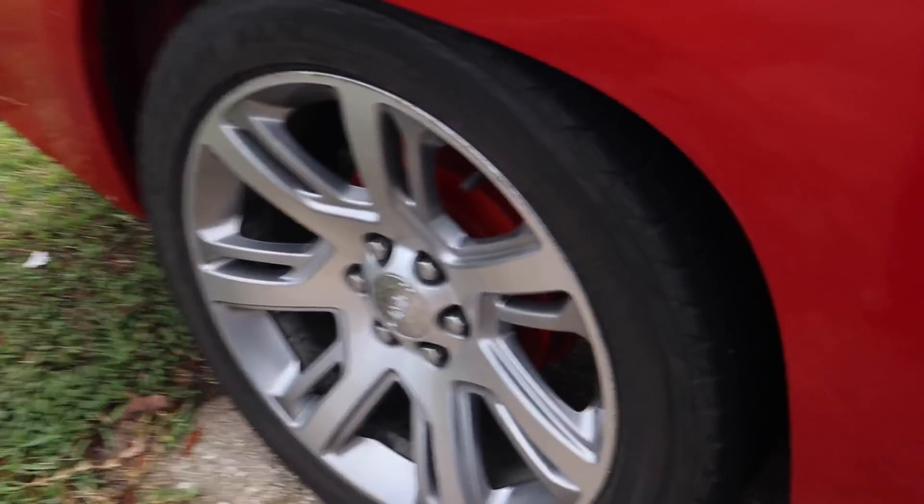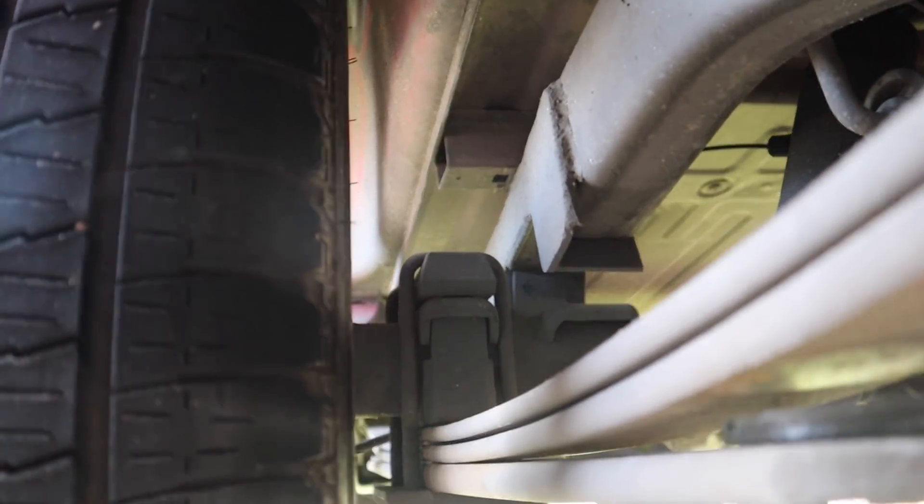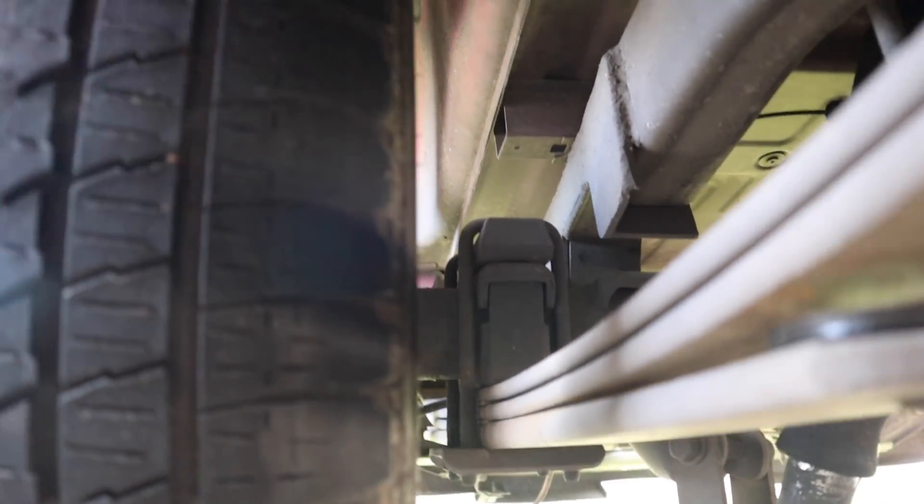What's up guys, today's Sunday. Let me show you a truck they brought me yesterday — it's pretty messed up. I know I have to redo the notch and just do an underbed notch. It has a block on top of the saddle where the saddle should sit, and then the U-bolts are there, so I have no idea what kind of flip kit it has. The flip kit is gonna have to get replaced — there's no saddle on there. Let me zoom in: it's literally the flip kit, the block, and they're just chilling. Those shocks — I guess they're air shocks or shock extenders.